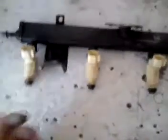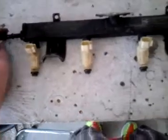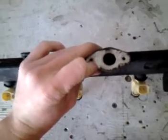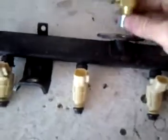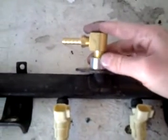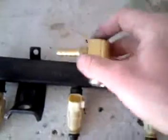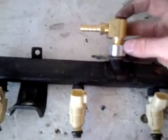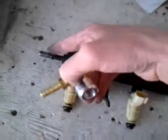This is designed for a returnless fuel system, but the 924 already has a return fuel system, so I'm going to be using this spot up here, which is where the Focus pressure regulator was. I'm going to weld this on — I may put a metal piece here and have it come straight out the side. Then I'll have an incoming line and a return line for fuel.